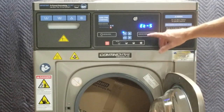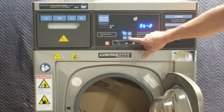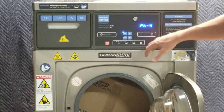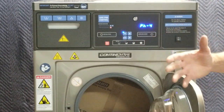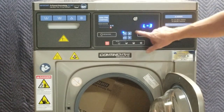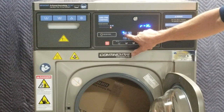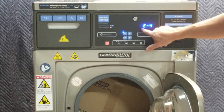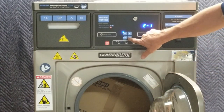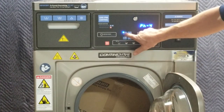I'm going to set it to E4 and set extract time to five — but actually, since we're in a wash step, we don't need more than two. I realized I made an error, so I'm going back to phase three and scrolling through with the program button to where I made the error, which was the extract setting. We don't need a spin in the first wash step, so I'm going to put it down to E1, which is a simple drain at wash speed.